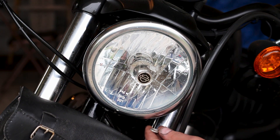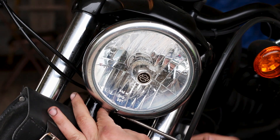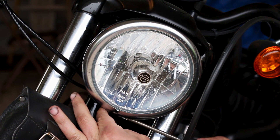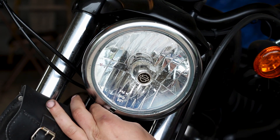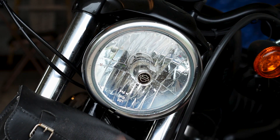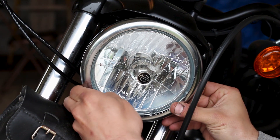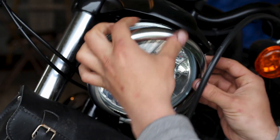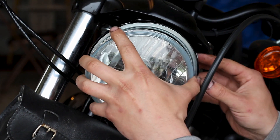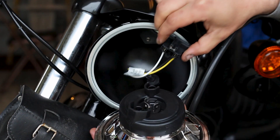The first thing we've got to do is come down here and disconnect or undo this little Phillips fastener. It has a nut on the back side. Just hold that with my finger as I unscrew the outside of the bezel. Now that that's loose, set these aside. I like to keep my fasteners together. I'm going to just pop this bad boy off of there. We can pull this out and there's just a single plug here. Disconnect just like that. Super simple.